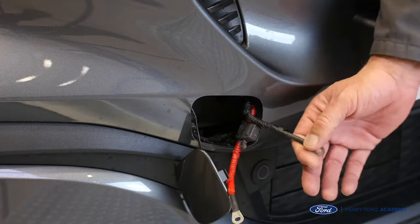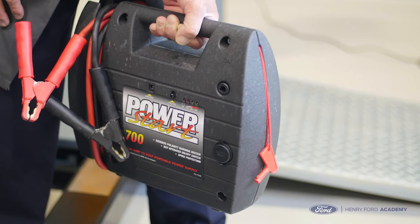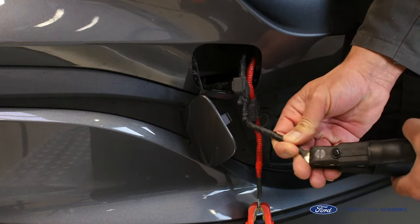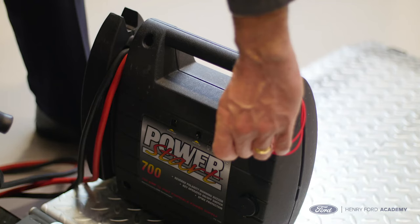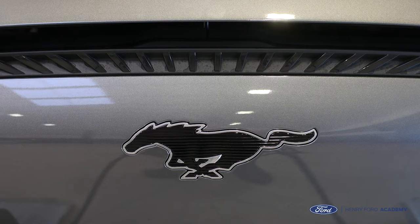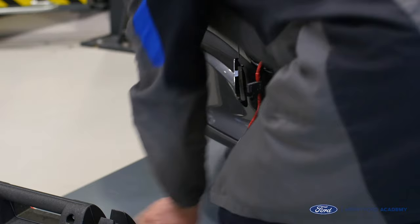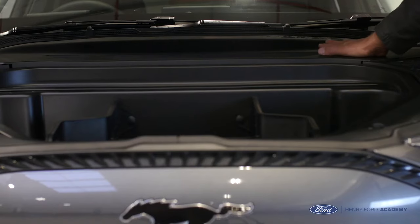Get hold of your jump pack or a spare 12 volt battery. Connect it across the two wires. As soon as I energize the jump pack the frunk pops open. Now that the frunk has popped open I can open it further to gain access to the 12 volt battery located inside, and then charge that battery or jump start it — whichever scenario you prefer. And that's how you get access to the vehicle when your 12 volt battery becomes discharged.